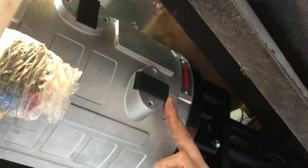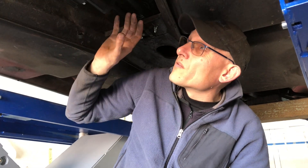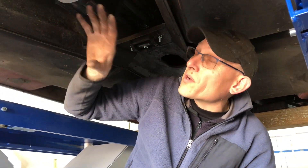Water comes out the side — that's all very easy access. And then we've got space behind. We've got loads of space to put batteries in, so the car's going to have a 44kWh pack. We're going to put 10 modules in the front and 6 in the rear. I've got the battery box, so in a minute I can show you how that fits, and we can talk about where the charger and the inverter are going to go.